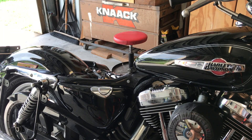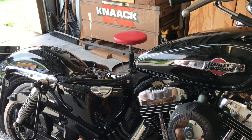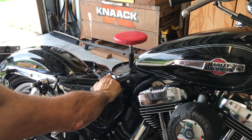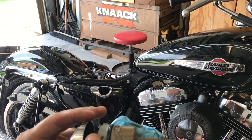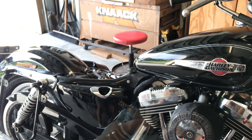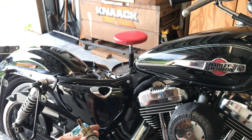All right, we ran through the things you should check on your Harley. That will keep your Harley running tight. You will notice things that are loose vibrate. If you have any questions, just ask. Let's check the oil one last time before I put the seat on. One of the biggest mistakes with these bikes is the oil settles into the dry sump and gives you a false reading. A must — start the bike, run it for a few minutes, then check the oil. We ran this about five to ten minutes ago, we checked it, and we've seen the difference. Let's check it again. As you see, it's a little more than half — that's where I like to see it. And I find that I don't have problems with the oil working its way through the breather and causing a mess in the air filter.